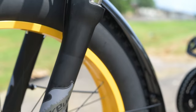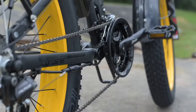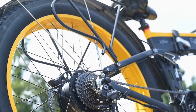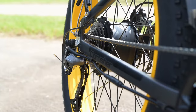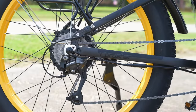Next, let's talk about the gears. The XF690 is a 27-speed with a 3x9 crankset utilizing the Shimano M370, and from a usability standpoint they were pretty easy to use. The one thing I would do is adjust the derailleur setup — that can be a bit of a long process with some trial and error. Right out of the box it probably could have used some adjustment, but it wasn't too bad. It just felt off by a little bit in some of those gears during the ride test.